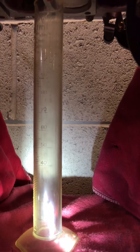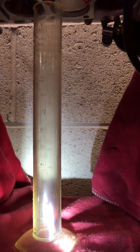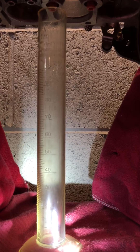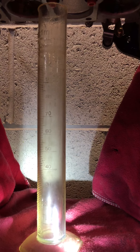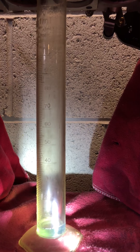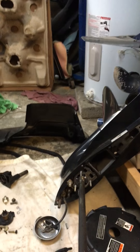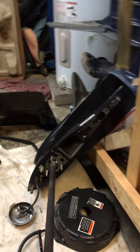Right underneath, directly underneath number three injector still, I am going to switch it over to 50 pulses at 10 ms and we are going to pulse it three times. One, two, three. Oops, didn't do it right — messed that one up. Had it halfway between the first and second setting. So there you go — always watch what you are doing.